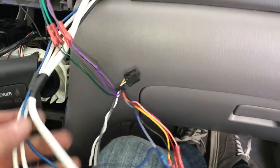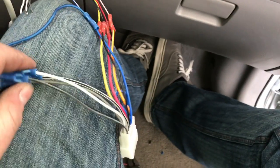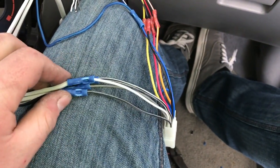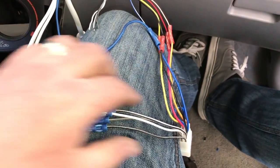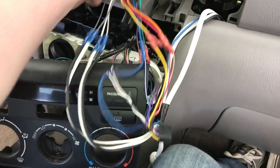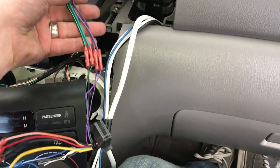We're starting to hook up speaker wire. The speaker wire from the amplifier's speaker output we ran all the way from the back of the amp up here. The reason I'm doing this is so I don't have to run new wire through the boot of the door — we're going to use the factory wiring because we're running about 75 watts RMS tops. If you go any higher than that, you'd want to upgrade that wiring. Running from the back of the amplifier into the wiring harness — when we plug this in, that speaker wire will go from our amplifier right into our wiring harness, and our wiring harness goes through the doors. So you don't have to run new wire — super convenient. You can also do that for the rear speakers as well. With this Corolla, the rear speakers are pretty accessible in the back trunk area, so we can run direct wires right to those speakers.